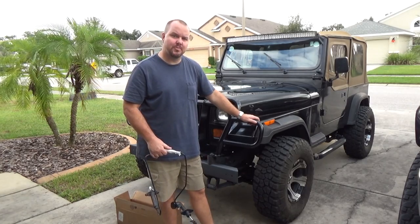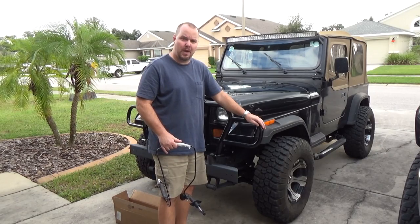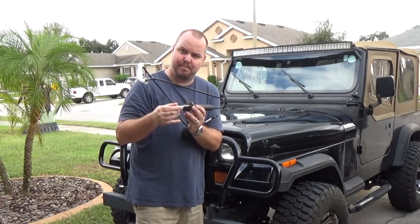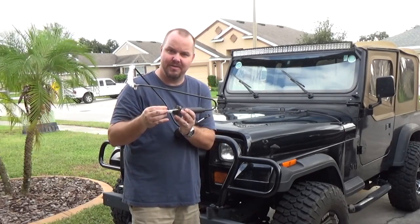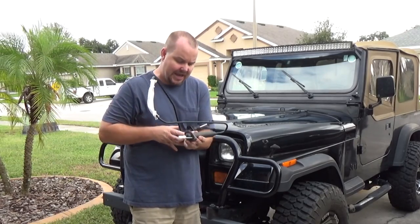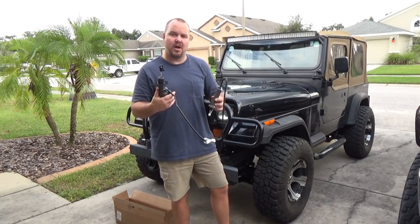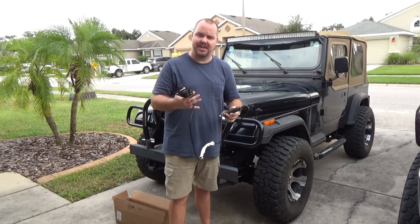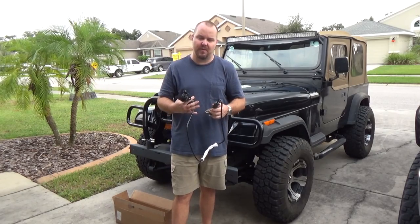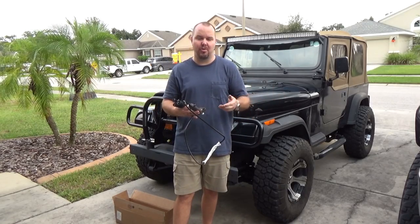Today on Chris Does What, I'm looking at this 1994 YJ. The slave cylinder is problematic — this little push rod is pushing out and won't go back in. We're going to pull this all apart. This is a pre-bled system I bought off Amazon. I looked at the same system on AutoZone and O'Reilly's and they wanted $70 more — this was $100 on Amazon. See the link below if you want this part.